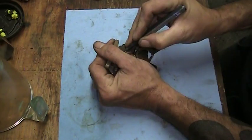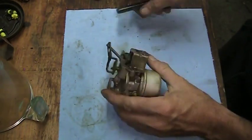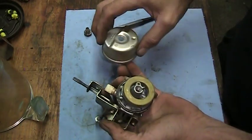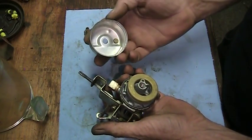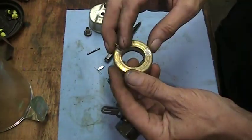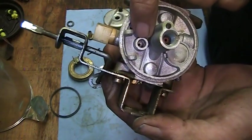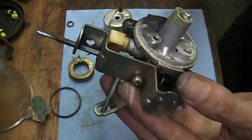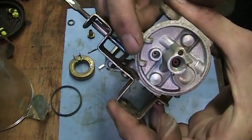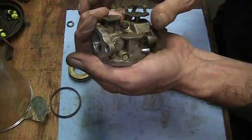The carburetor is off. I've made a physical scratch mark on it so that once it's out of the sonic cleaner I'll be able to tell where it was. The flat part of this bowl you want lined up with the float pin. It's actually not very dirty in there — there is a little bit of dirt, but not a lot. You can just see the white rubber seat in there. It's a brass float. I don't hear any gas in it. What I'll do is put a little bit of WD-40 penetrating oil down in there, then use my blow gun and air compressor and force air into this inlet fitting. The volume of air going in is far more than the volume that little seat can pass, so it'll just shoot that seat out. You've got to cup everything in your hand and make sure it can't go flying across the shop and catch somebody in the eye.